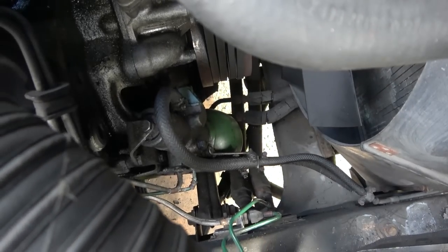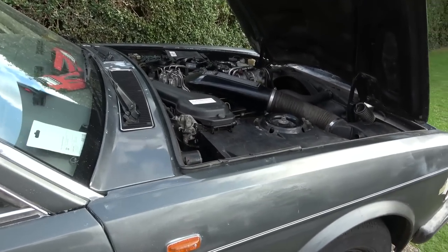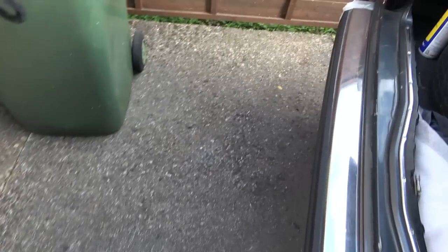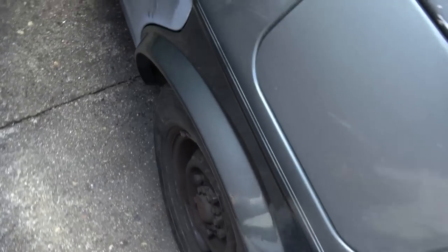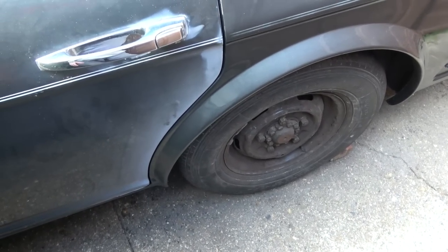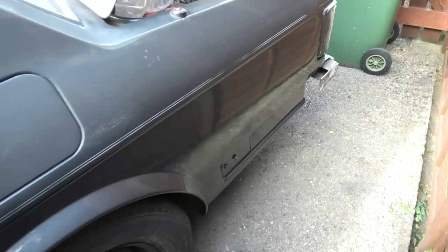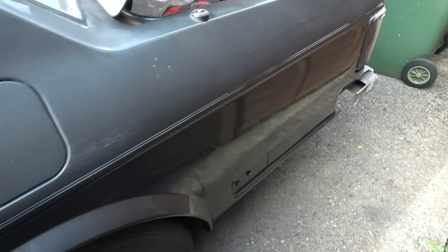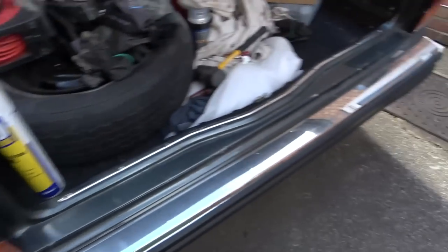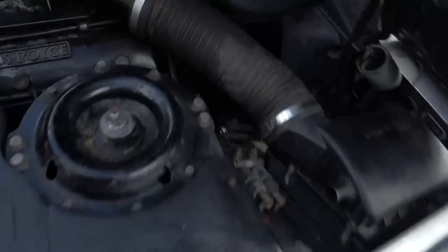I've spent yet another £500 on different parts. Those two spheres weren't that expensive - about £80 odd - and I bought all the repair things needed for underneath this suspension. I'm hoping once I do that, maybe apart from some fuel lines underneath, I might get away with the rest. I've been spraying the bodywork up - you can see we're starting to get a nice shine. I need to flat it all back as there are a few runs and stuff on the top coat, but I'm tempted to try for a rattle can finish on the car.